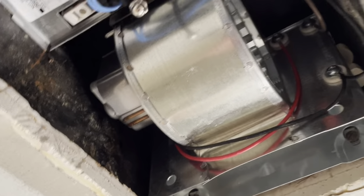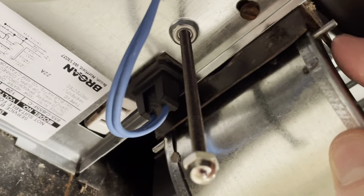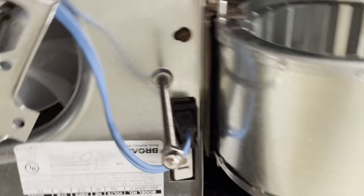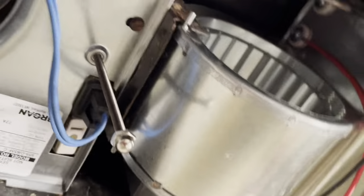Next part is the heater fan. There are two holes, one on each side — you're going to need a long flathead screwdriver to access these screws. There are also these little metal parts, little tiny rods, and it's going to rest on this little housing here and swing down. Once you unplug the heater fan with that red plug, you'll be able to swing it down, access it, and change it.